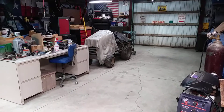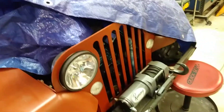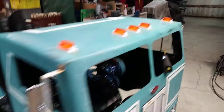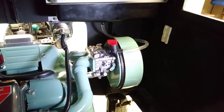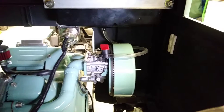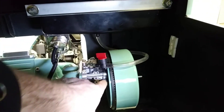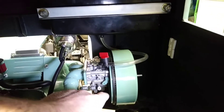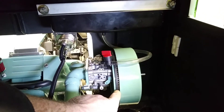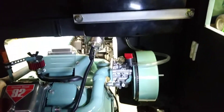I also like this air filter better — it just gives it more of a factory look. The outer cover is just off one of those Massey-Fergusons, a 10 or 12-horse Tecumseh. The back plate I made — it's a little heavy, it's 3/16ths. It was actually the other cutout from the grill on the Jeep, but it was the right size for those filters. I dropped it down for the fuel line clearance rather than centering it, and I didn't realize at the time but it saved me a lot of work with the center stud — now that stud falls underneath the opening for the carb, so I didn't have to build a bridge over it. That helped a lot.